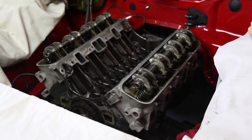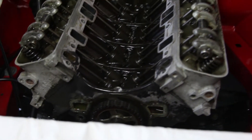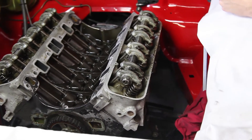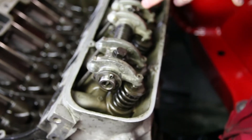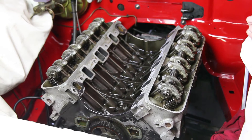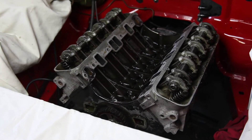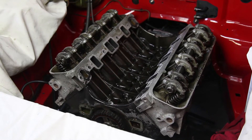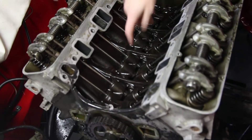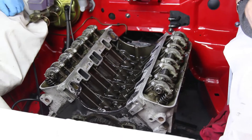Steve's been working his magic and had a productive few hours. The intake manifold is now off, along with the ancillaries, front end system, and timing cover. This has allowed us to do a little inspection of what's been built. We've noticed a mismatch of 1971 and 1975 very early style rockers, which we can tell by the date stamp on them. They've got a smaller pad that sits on top of the valve — not the style of rocker we use; we use later style genuine rockers. We can also tell that tappet preload hasn't been set — there are no shims under there. The heads will have undoubtedly been skimmed if they'd done the job properly. The block is an early block, pre-'82 — an SD1 block — you can tell by the smaller webbing across the valley. I think it's about ready to be pulled out now, and the job's going really, really nicely.